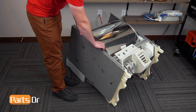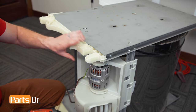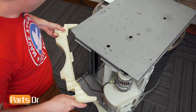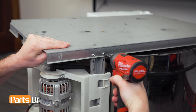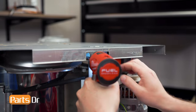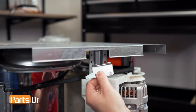With the idler pulley removed, set the drum and chassis assembly on its side — the side with the belt will need to face up, and this end will need to face down. Next, remove the chassis panel bracket assembly by removing this screw, then pull this end towards you and rotate it out to remove it. Next, remove the two screws for each chassis beam where it connects to the inlet panel, followed by the bracket. Take note of which bracket goes in which location — this one has a bracket on both the front and back side.